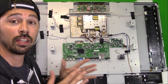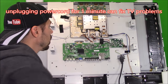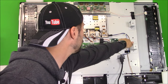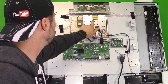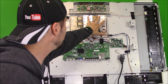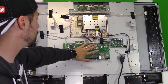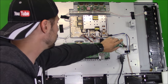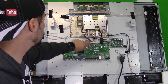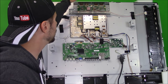Let's first identify the boards. Here's my power cord — I go ahead and plug it in, and use caution, you can get shocked working on TVs. The power cord plugs in right here, and following these wires leads to the power supply board. This is the power board, and it converts AC volts to DC volts and distributes 5 volts standby voltage to your main logic board, and also distributes voltage for your audio board — which is usually built into the main logic board — and also distributes voltage going out to the T-CON board, which gives you your picture on the screen.